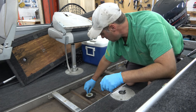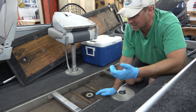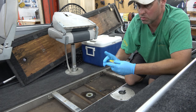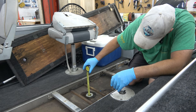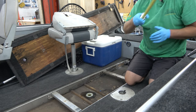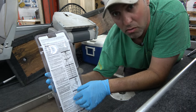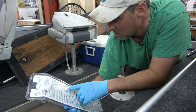I'm not sure how deep my tank is, but my tank is extremely full because I thought it was empty. I went and tried to fill it up and kept trying to put more gas in it because I thought it was empty, and it just wouldn't go in anymore — that's when I took a closer look and realized the gas gauge was broken. I'm just going to use an old ruler that I don't really care about, put it down in there and measure how deep it is. It looks like it's 7 inches. On the back of the carton there's a little graph — tank depth and the float arm length associated with it. So if we go 7 inches, float arm length should be 5 inches.